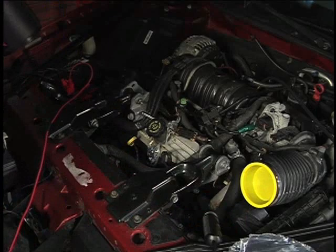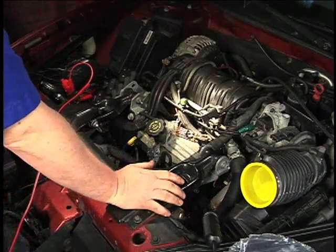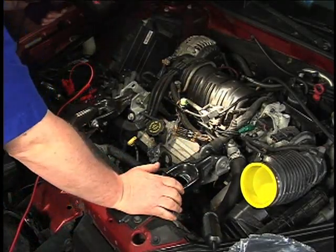Just take some simple plastic — I don't care what you use, just some kind of rubbery plastic. Take some small pieces, stick them down in the hole where you know the leaks are. Here's a small piece for our manifold fitting, and let's roll the smoke again. We're going to buy a part here and a part here — let's see if we need anything else. Smoke's rolling. Let's get the bright light on, and lo and behold, we've got other leaks it looks like.